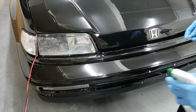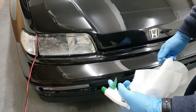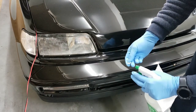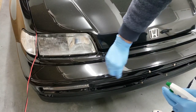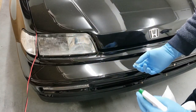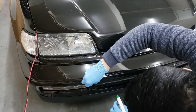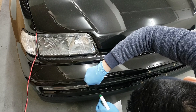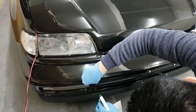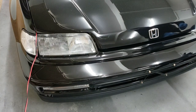To start cleaning some of the chips, I'm just going to use some clay as well as some water to scrub off any of the dirt or sealant that's on there. A clay bar is usually able to remove any of the sealant or wax on paint. So all I'm going to do is just wet the area and then rub this over a little bit — like so. I'm also going to clean it with isopropyl alcohol later.